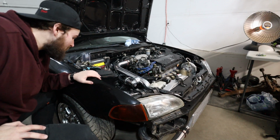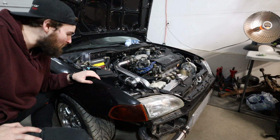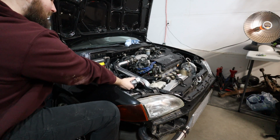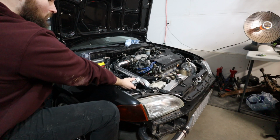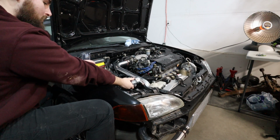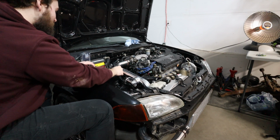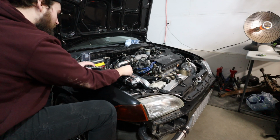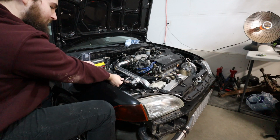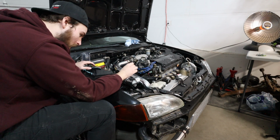And just like that, our engine bay is put back together. If we needed to, we could start this rig and move it at any moment. The blow-off valve is on a lot tighter than it was before. If you remember back quite a few videos ago, I could just barely touch this thing and it would move. So I've reseated it, but it does like to kind of unseat itself. I'm just going to tuck that down so there's no tension on it. Vacuum line's connected, this is connected, but don't worry, this is getting blocked off.